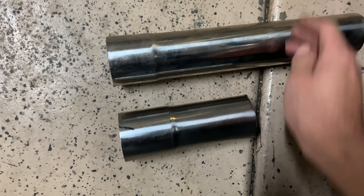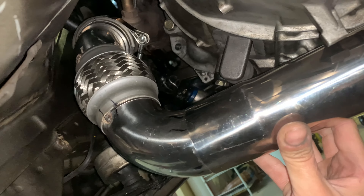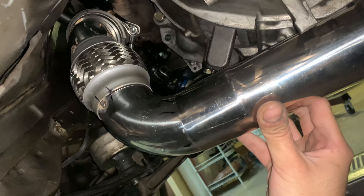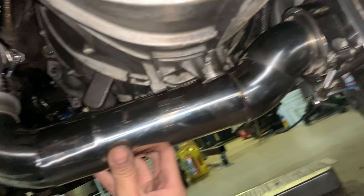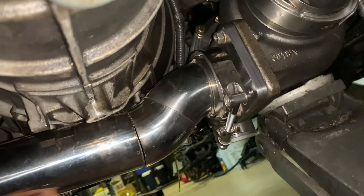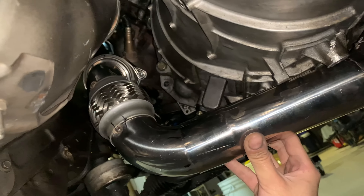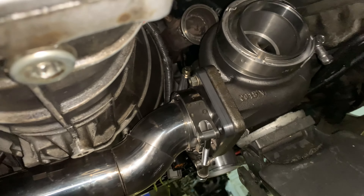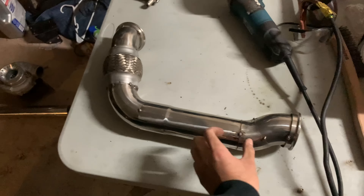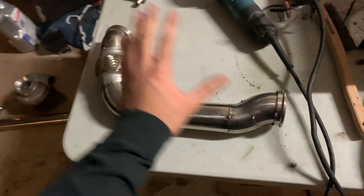We're going to cut this piece down — I measured the gap and I'll cut a little extra so there's room to grind it smooth. I got another pipe that's a close match: V-band, 45 degrees down, flex pipe, 90 into a straight, then two 45s — one up and one back down, originally a 90 flipped — into the V-band, into the T4, into the turbo. That's pretty much the left side. Still need to do the wastegate hole and finish tacking. Now I'll start marking up the passenger-side bank one.